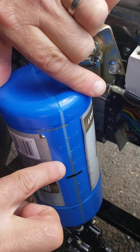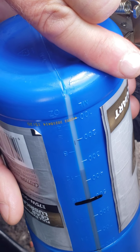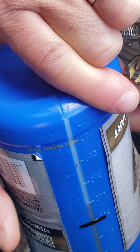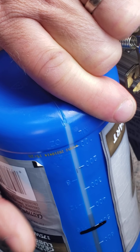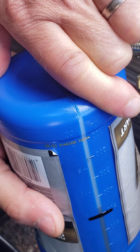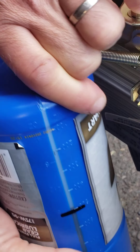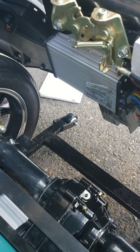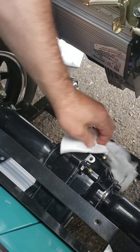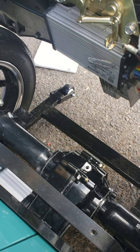As you can see it's slowly going down. We can squeeze it a little bit to speed up the process. Right now I have about 100 milliliters inside — about 150 now. By the way, 150 is enough; 200 is the maximum you want to add. I added around 180 to 200 milliliters — that's all you need, between 150 and 200. It's just going to splash inside the differential.